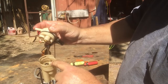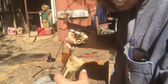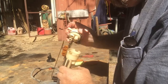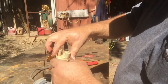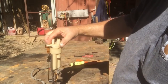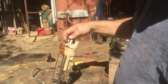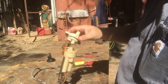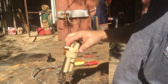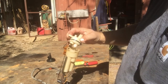Basically, we're doing away with this whole housing - this is your suction line. The return line makes a loop with whatever blows by on the duck bill. The idea is to do away with all of this and end up with something that's less maintenance intensive. You can look up Hutch Mod or 7.3 fuel tank mod on the internet - it's just to do away with this plastic housing and these screens and let everything get caught by the fuel filter, which is an easier deal where you don't have to drop your tank just to clean these filters.